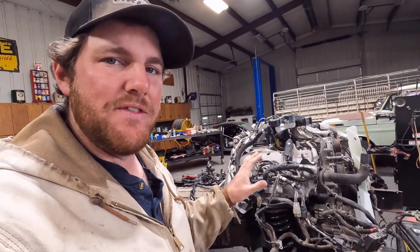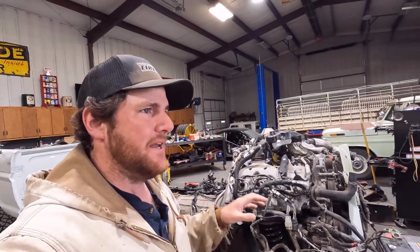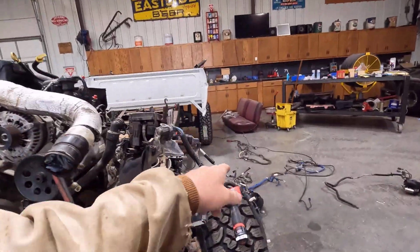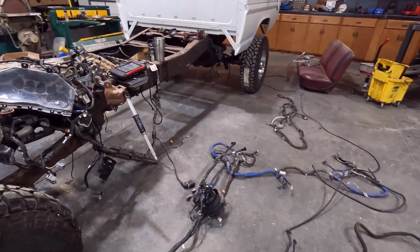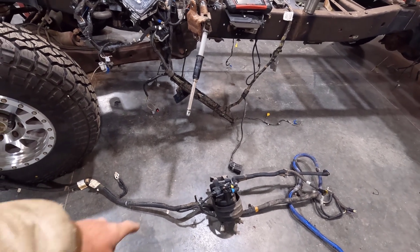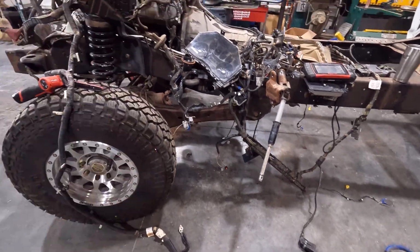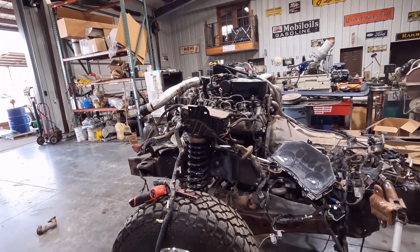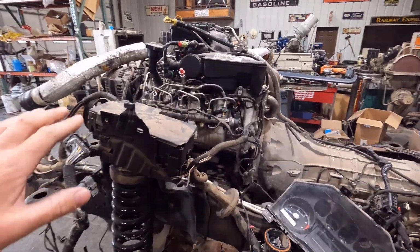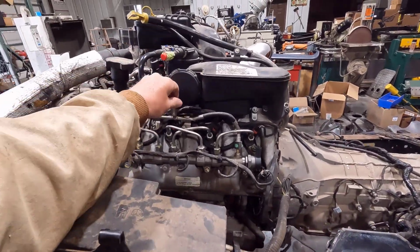But for now, today, I think I'm going to work on the fuel system and try to get some fuel to this thing. I might try to wire in the OEM frame harness that goes to the fuel pump, or I could just hot wire it. It's just a ground and positive to the pump, and it should run. If I hot wire it with another battery, just enough to make it run, I guess it would probably work. The only problem is it's all quick connect fittings, and I'm not sure if I have enough to hook everything up to the engine.